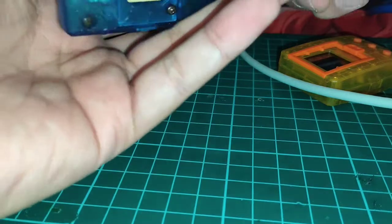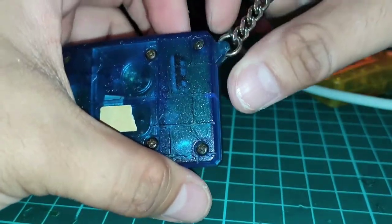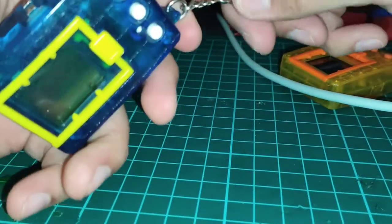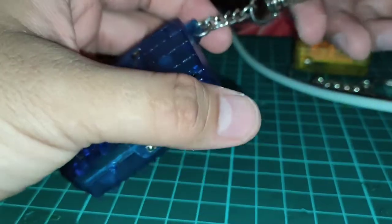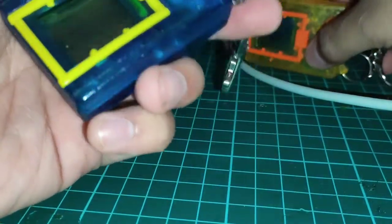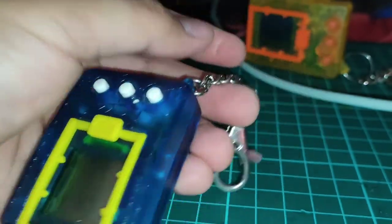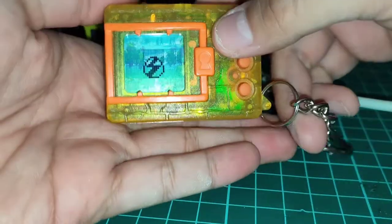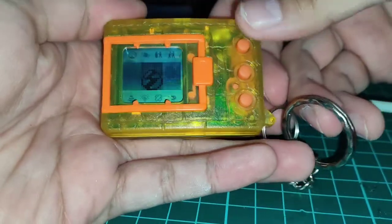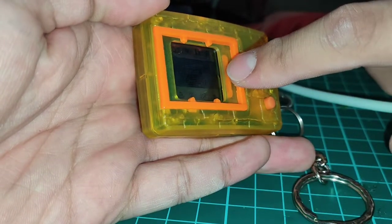The English releases, as far as I know, got this pretty cool keychain that you can use as a keyring — attach it to your backpack, do whatever you want. Japan releases and all releases up to today, at least the older '97 ones, have like this jump ring. The easiest way to deal with this is just take off the four screws, pop the back off, and take it out — then you can replace it with a traditional keyring. They also have the lobster claw which is a lot better for quick releases off your bag, keys, what have you. And that is how we board swap and get into your Digital Monster.